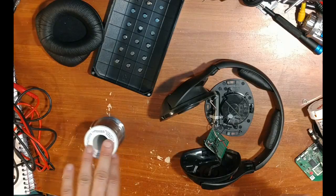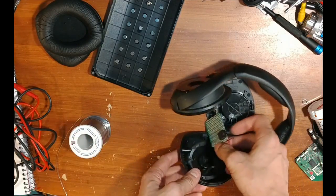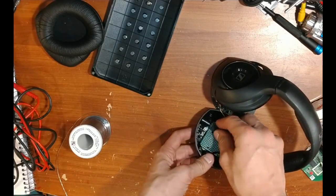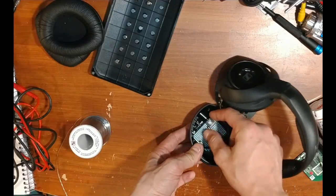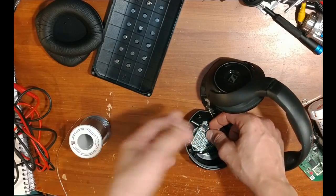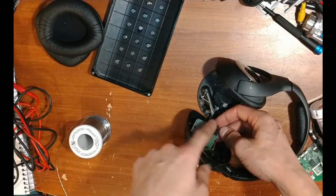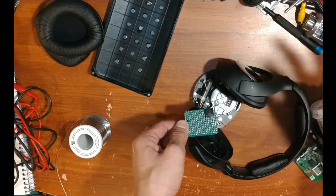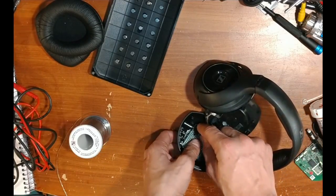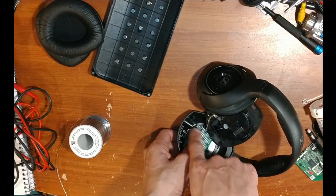Now that it's all been tested and confirmed working, the next step is to put the circuit board back in place. On mine, the hole for the jack is a tiny bit too small for the jack I'm using — you may or may not run into this depending on which jack you choose. I salvaged this one from an old electronic component, so I just need to find the right drill bit and drill that hole out slightly so it fits.